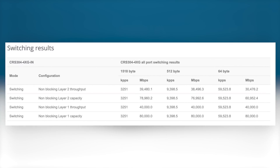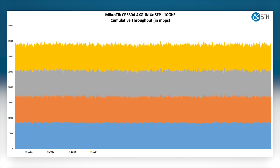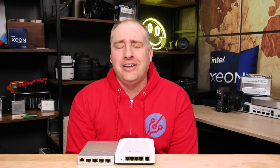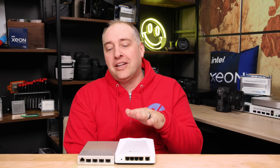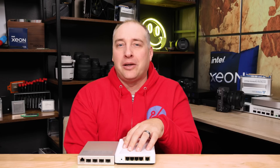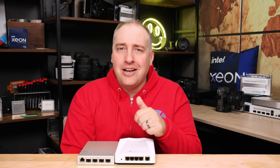For simple Layer 2 switching, this can perform decently well — that's often what we test — and we got results pretty similar to what MikroTik got. On the flip side, when you start doing bridging and routing and adding more Layer 3 features, performance drops really fast. You're going to start seeing something like two gigabits per second. This has a ton of features because of the MikroTik management interface, but the overall performance is limited by the very low-power switch chip. This is designed for low power and really just connecting devices over a Layer 2 network. It's not a core switch giving you full 10 gig performance across all ports for things like firewalls — it's more for just plugging stuff in and having it go fast.